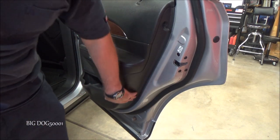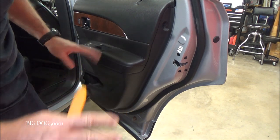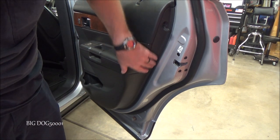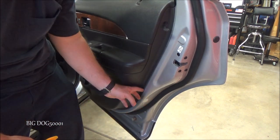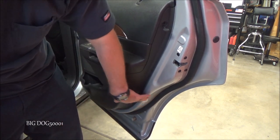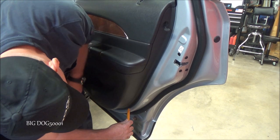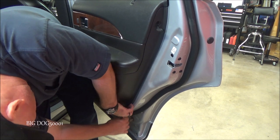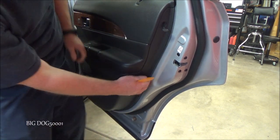Like many door panels, now that we've got the screws out — and there could be more, so always look before you start ripping stuff away, make sure you got all the screws out because different models may have more — we've got a series of clips all the way around to deal with. There's a little edge right here; usually you can just grab it with your fingers and pop it out, but in this case because the metal is rolled under we're going to use a little trim tool, put it in there to help get our fingers under and pop them all the way around.